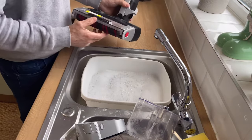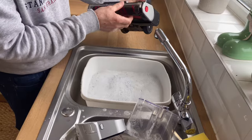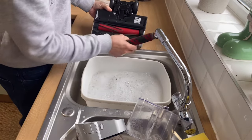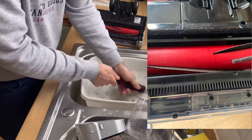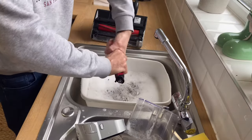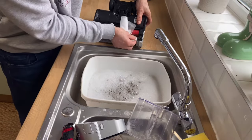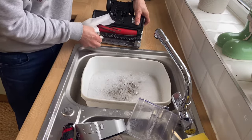We come to your main head — this button here removes your soft roller. This is what traps all your hair, or should I say, filters your hair along this comb here. This can be washed as well — straight into the soft water, wring it out. Make sure you dry it on a radiator as well before you put it back in. Make sure this area where the comb is, it's all clean — this is where it traps the hairs.